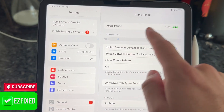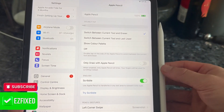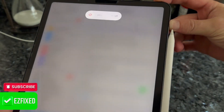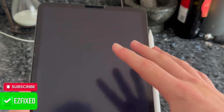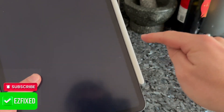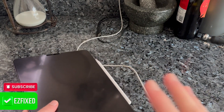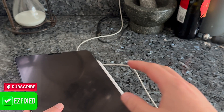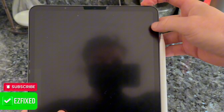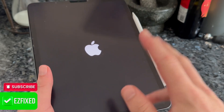If it's still not working, the last thing I'd recommend is turning off your iPad with the Pencil attached. Hold the power button and the volume up button, then slide to power off. Once the iPad is off, plug it into your wall socket to charge with the Apple Pencil still attached. Wait around one to two hours for everything to charge to full, then press the power button to turn the iPad back on — make sure the Apple Pencil stays connected the entire time. That should now have fixed any charging issues you were experiencing.